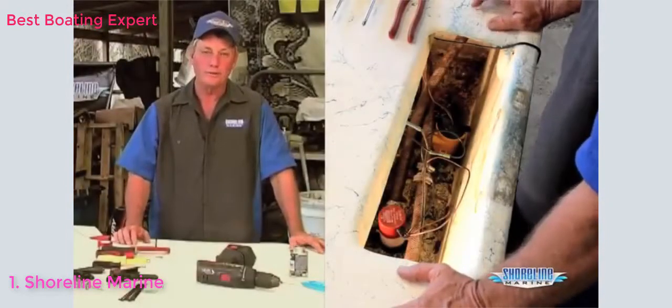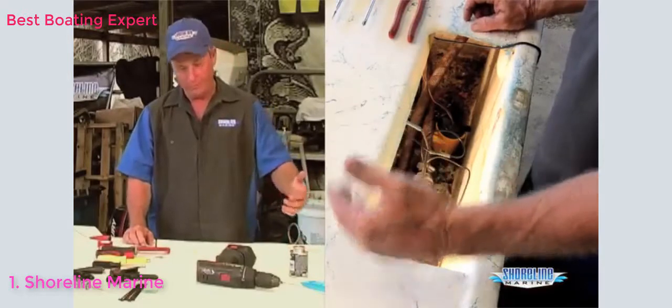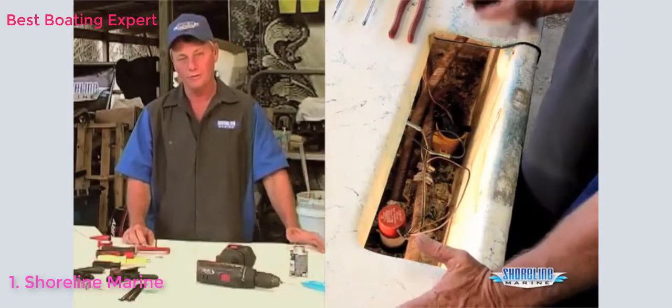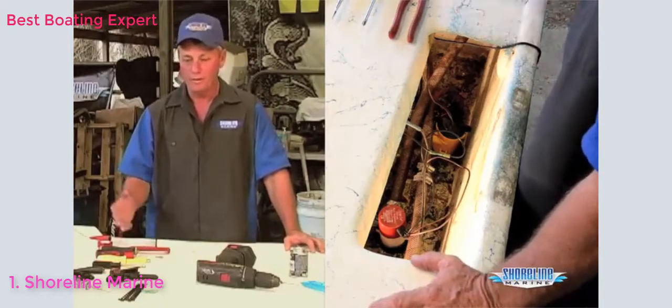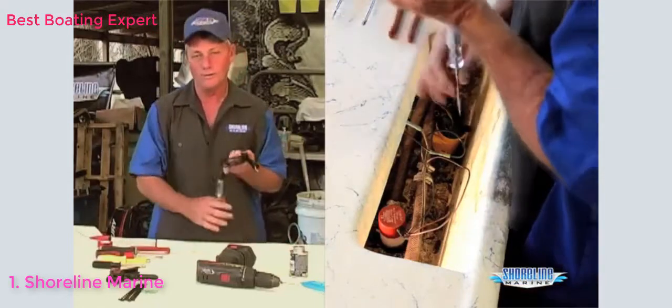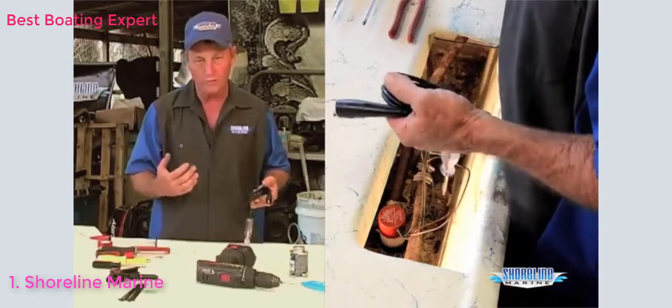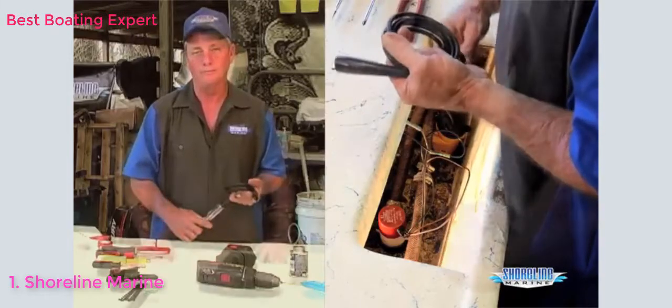Hi, this is Lloyd, Captain Weekend with Shoreline Marine Products. Just getting ready to go fishing this weekend. Checking all my systems over, found out my bilge pump doesn't work. Now I got to figure out why. Going to come in with a test light, make sure I've got power going to it, also ground, and then we'll go from there to see if our pump's bad or if I've just got a wiring problem.